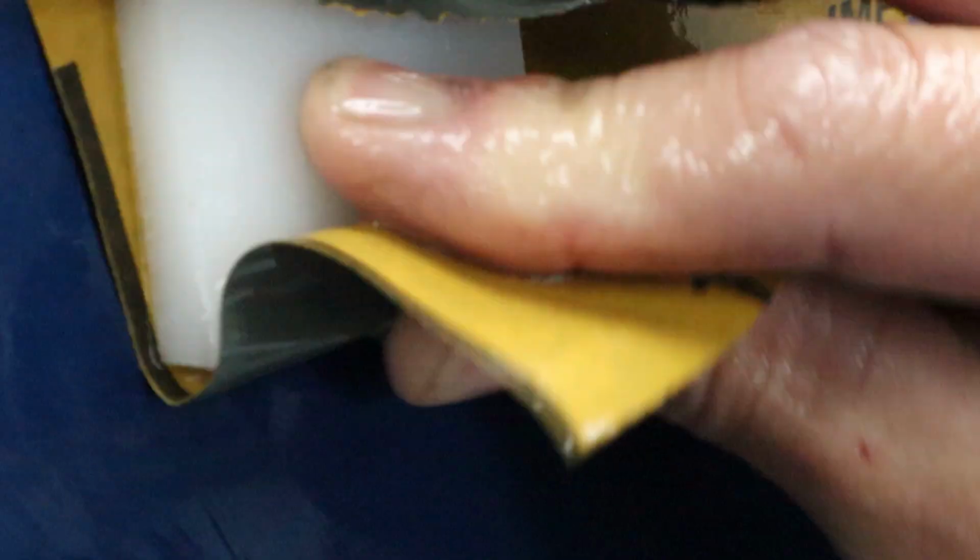So I'm gonna sand it some more. I don't wanna try to polish that out with the polishing wheel. I wanna sand it out. And it'll work around the area a little bit. And a lot of times I'll stop a little early because I know I'm gonna go over it with the DA. If I was hand sanding this, I'd go ahead and get it all the way out.